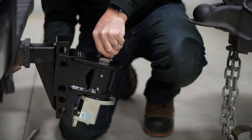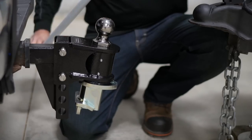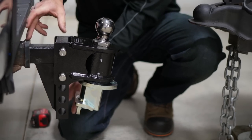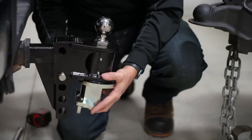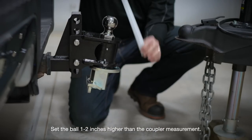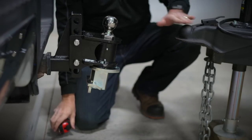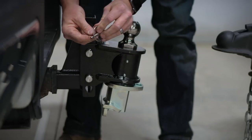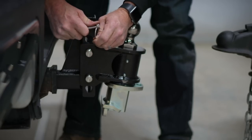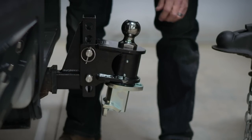The head unit comes pre-assembled in the box in the down position. It doesn't look like we'll be able to get up high enough to achieve the one to two inches higher than the top of the coupler that we need. We will need to change the shank into the rise position, where the top of the ball needs to be anywhere from one to two inches taller than our coupler height measurement. We're at 23 and three quarters — one inch taller than the coupler. These retaining pins have one way where they shut all the way, and one way where they do not and a gap remains. Be sure you're using these pins in the position where the ring completely comes into contact with the pin itself when shut.